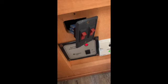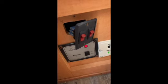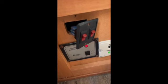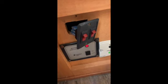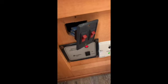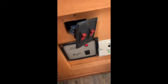So I'm back under here, just basically neatening up the wires. We chase this back in, and next we just wire in the switch, and hopefully the step will go in and out. So the switch on the left is currently the step override switch. It's 3 wires to it, positive, negative, and then the white wire to the controller. I'm going to remove that, abandon the white wire, and then install a reverse polarity switch to drive the steps. I'll kill the power before I do that.